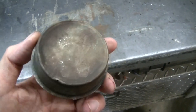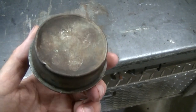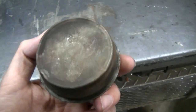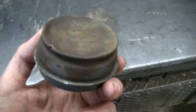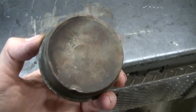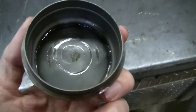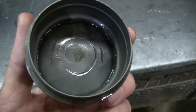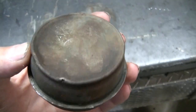Today's quick tip is about dust caps. Most of them I find are destroyed or look like they've been beat on severely, and there's no reason for them to be all out of shape. You can see this one has actually been hitting the cotter pin in the hub because it's been smashed in by somebody that doesn't know how to install one of these.